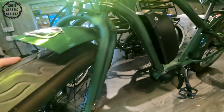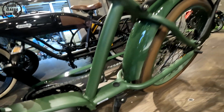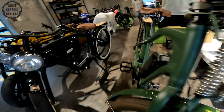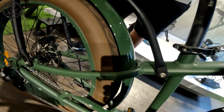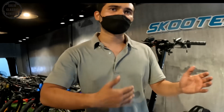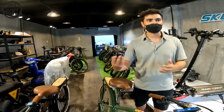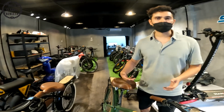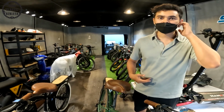Okay, so the harmony between the pedal assist with the motor and then your gearing. So when you're in proper gearing, especially when you're starting, usually you would start on a low, and as you make it in faster speed, you will increase. It's identical with an electric bike. However, if you want to get in speed faster, but you will be consuming more energy, what you can do is that you can press the throttle first to get into speed. So when you get 20 to 30, then you don't have to change your gearing, then you start cycling. That's one way of not having to use all the shifting that you would normally do, but it's much higher energy consumption.